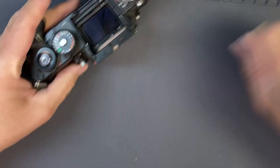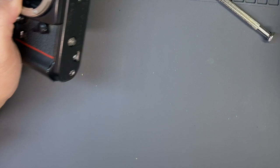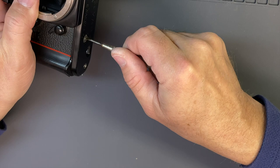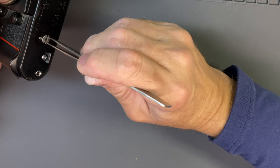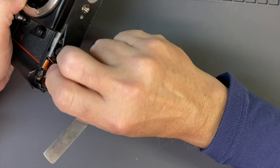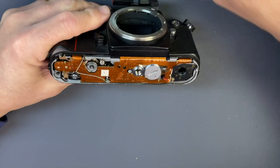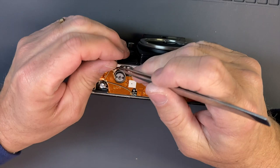My first job — I always like to check what it looks like under the bottom. Everything goes down to the bottom, so if the bottom's all messed up I know someone's been into it. That screw goes, and if there's a screw here that would go too. You don't have to take the cover off; the cover was missing on mine anyway. Take off this screw here for the motor drive coupler — it's just on a keyed shaft, pull that off. That gear underneath there can actually raise back up and then the camera does weird stuff and you're wondering why. It's not a big deal; you just have to re-time it, and it's not really hard.